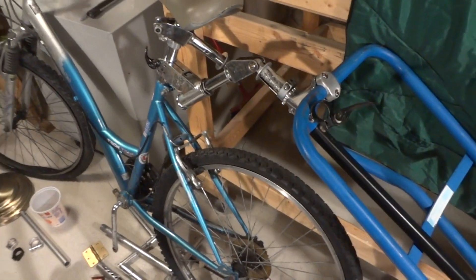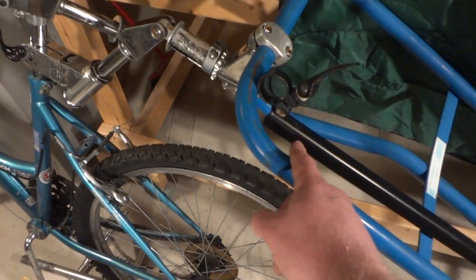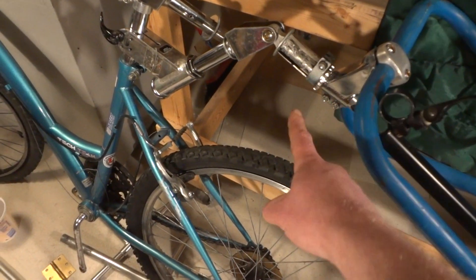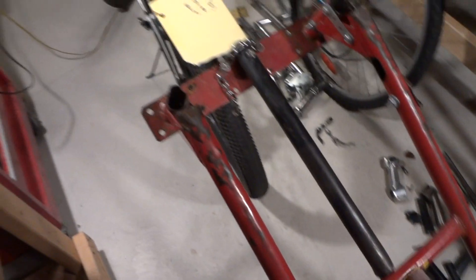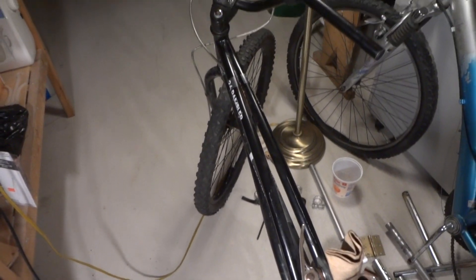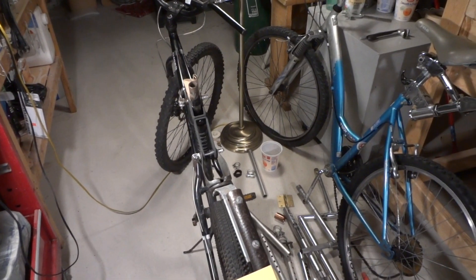When you load this up, it won't all be on your rear bearings and rear axle. I weighed it and this setup puts only two pounds on this connection point. This trailer weighs 50 pounds and I have the wheels positioned way back, so 15 pounds is going here — that's a bad design if you're just hooking to your bike. You want very little weight at that point since you're already sitting above the rear axle. When I finish these trailers I'll make riding videos. Thanks for watching!